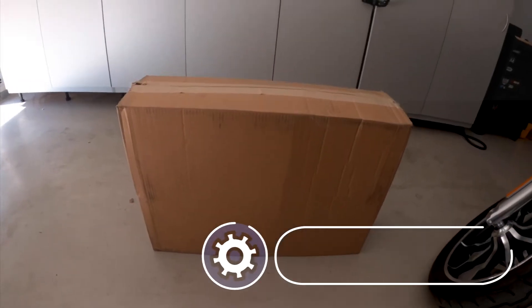The two bolts that go onto the bottom part of the frame are T45s, and then on the top part you have a quarter inch hex with a little nut on the back. This one is really hard to get to, and I'll explain that in a few minutes. Looks like Harley Davidson has already pre-applied some sort of Loctite on the top bolt, so I won't be adding more there, but I will be adding Loctite to the bottom bolts.